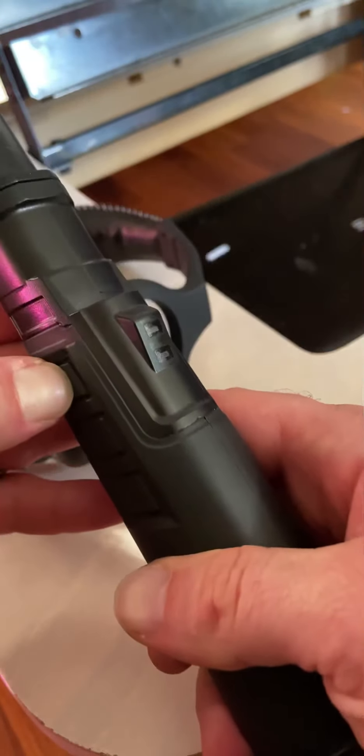Sound is coming out of the unit — you can hear that, right? Okay, so we're gonna shut this back down. That's off. Step one: we're gonna power up the headphones, hold down this white button, hear that click, hold that down, throw the power switch. Five beeps, now we got a blue light blinking slow — that's ready to be paired. We take this, hold down this button, hold down this button, power up the device — fast blinking, fast blinking. Now they're supposed to be paired. You shut these off, shut the power off on those — these are supposed to be paired now for life, according to everybody.